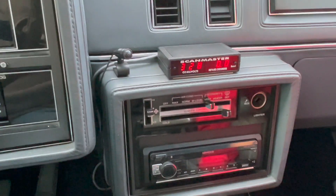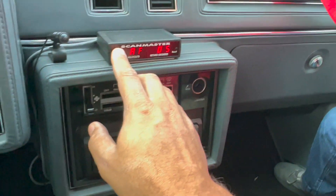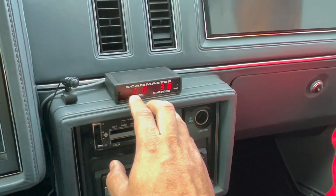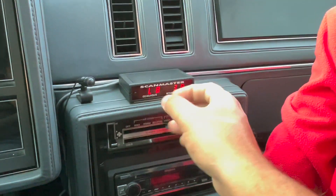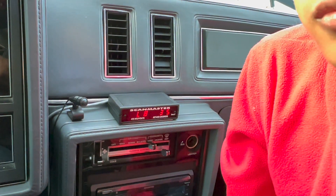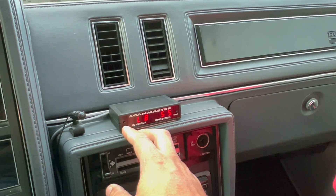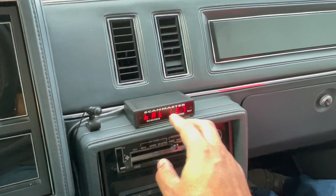The first screen is reading the oxygen sensor in millivolts. Next is the airflow ratio — actually this is the airflow from the MAF sensor, what the MAF sensor is reading. The next one is the load — it's the calculated load factor. Right now it's pretty low because we're not driving, but when you're driving those numbers should rise. The calculated load factor range is 0.0 to 25.6. Let me rev it and see what it does.